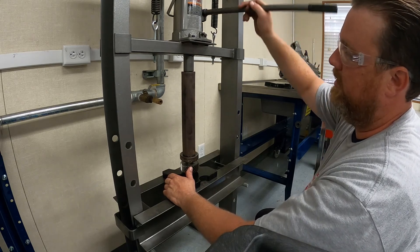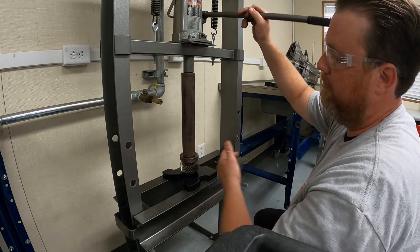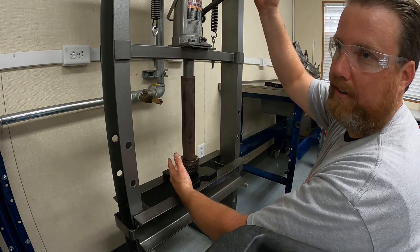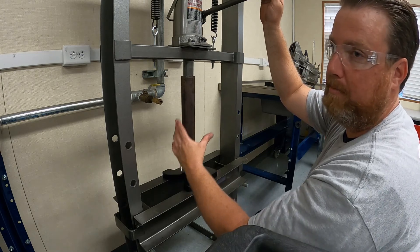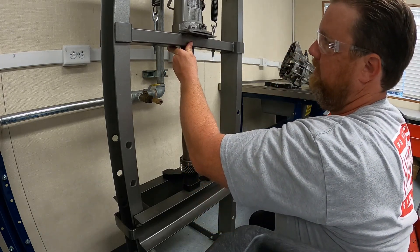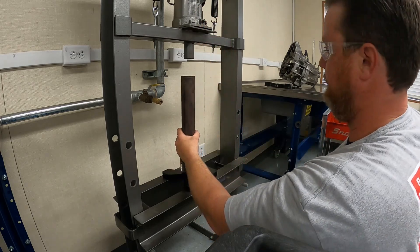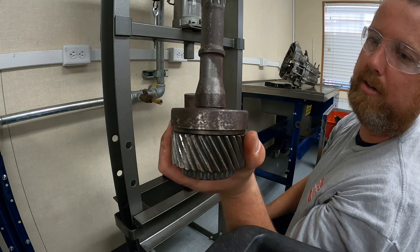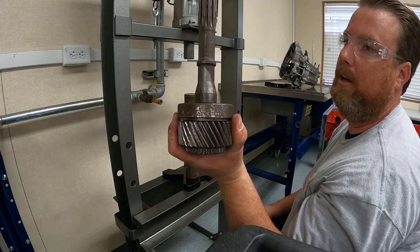At this point we're contacted so we can start to press the bearing down - it's going to creak and make some noises, that's completely normal. I want to double-check the bearing is rolling the entire time. It's starting to get very very difficult to press down on the hydraulic jack, so that's an indication that I've bottomed out this bearing. We'll stop and relieve the hydraulic pressure. These jacks sometimes need a little bit of help coming up. We'll remove our bearing installation tool and take a look - we can see the snap ring groove is fully visible and there's not too much of a gap between the input gear and the input bearing, so this is completely installed.